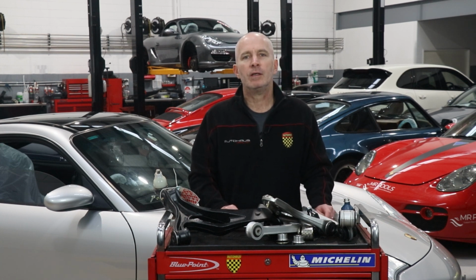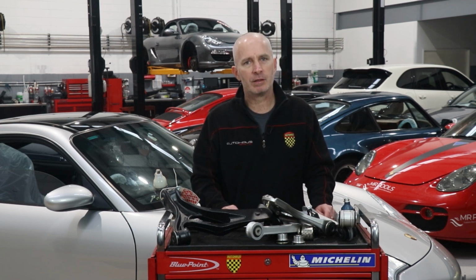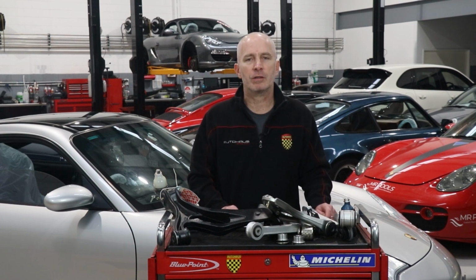So far, I've talked about springs, which might be torsion bars, and shock absorbers, which are the dampers, and also sway bars, which reduce sway and might also be torsion bars. Tying it all together are the control arms and suspension bushes. Control arms is a loose description covering wishbones, A-arms, and all the other arms which allow the suspension system to articulate and work together to maintain a more or less functional suspension geometry over the suspension system's range of motion.